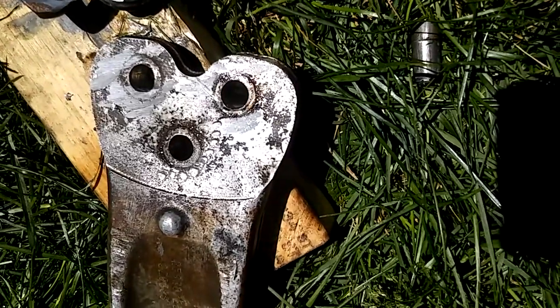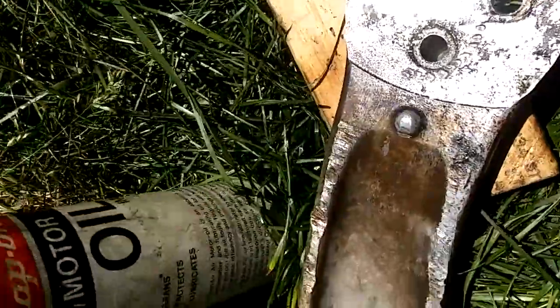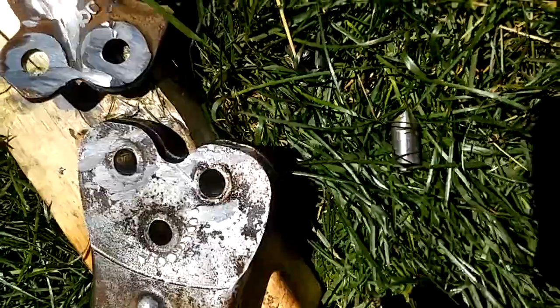This one is not all the way through the head — I drilled a hole. It's been almost an hour with this one. Of course use lubricant — I just use air tool oil. Drill the hole after you've ground the heads off.